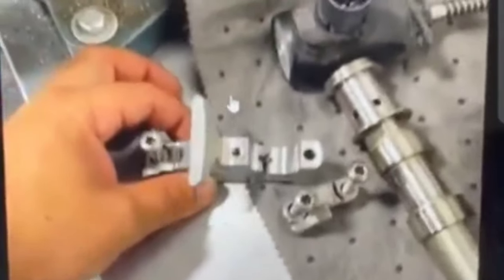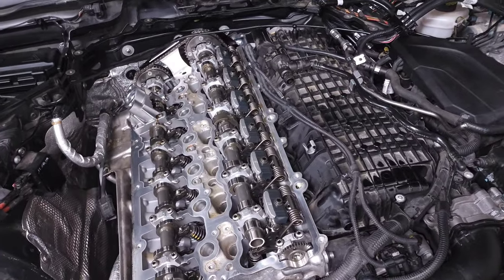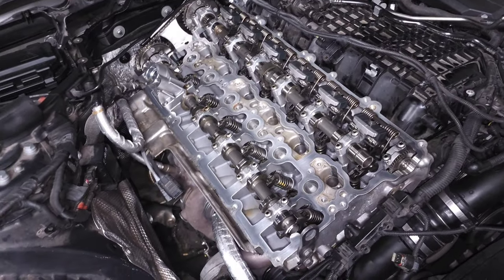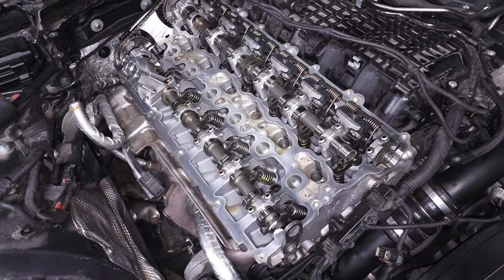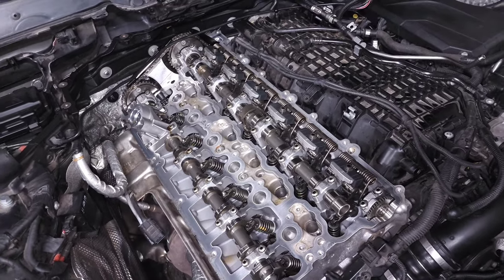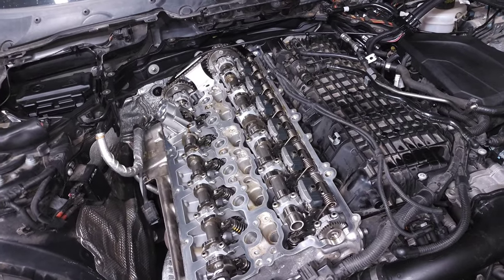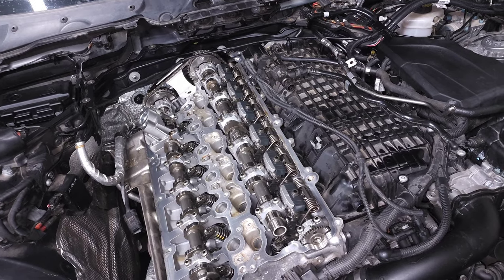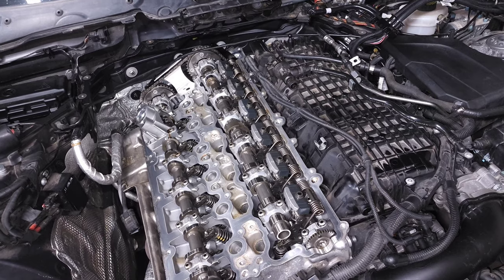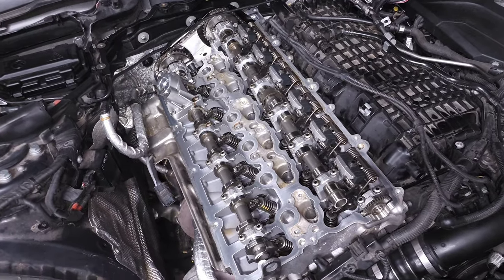Failures are sporadic so nobody's looking too deep into it. I just wanted to make this video since I'm looking at the engine right now — hopefully this helps if you're having this issue. If you or a friend have an annoying persistent misfire on a specific cylinder and nothing has fixed it, the next step I recommend is to pull your valve cover, check your cams, and make sure nothing is damaged. If something is damaged, you'll have to go through basically rebuilding your cylinder head. That's it for this video — thank you for watching, and leave any questions or comments down below.